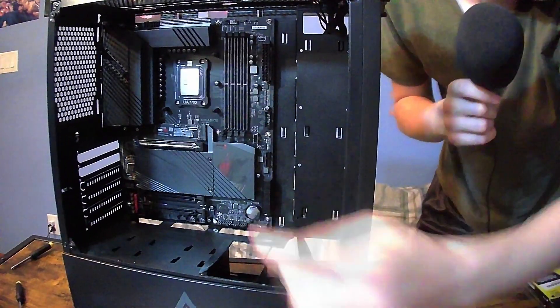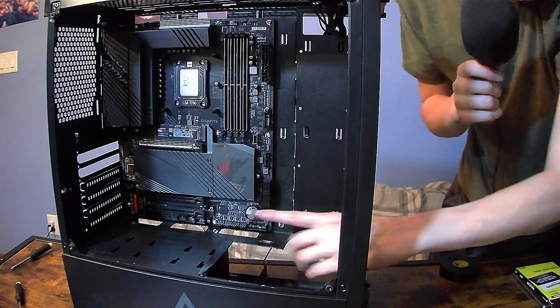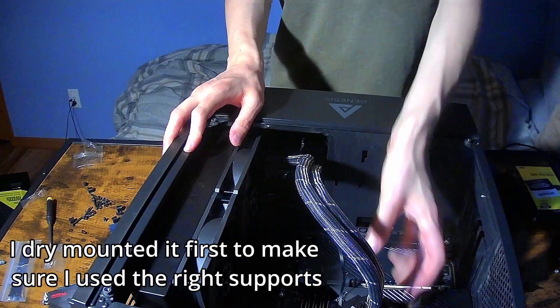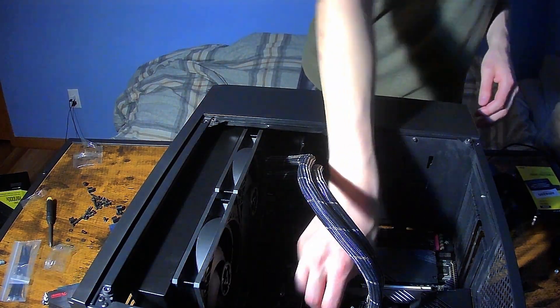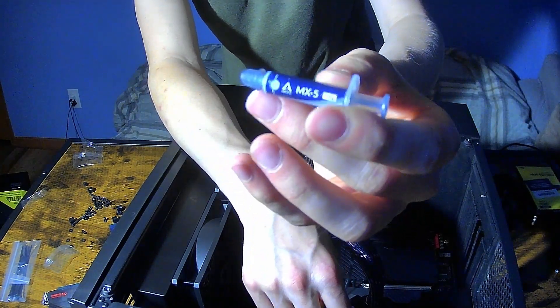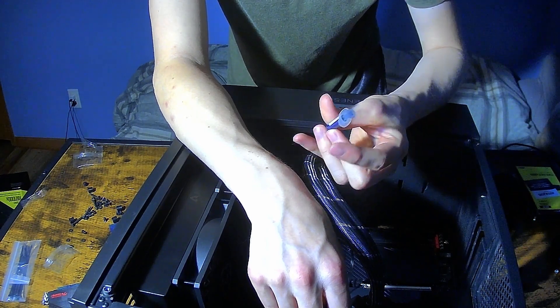I genuinely don't know how many days this has taken at this point — it's kind of all blended together. My cooler wouldn't fit. The radiator, to be specific, because apparently I measured it but there are cords that run along the top here for the buttons, and I didn't account for that. So what I did instead was I cut an absolutely massive hole in this section here so that I should be able to run the thing down that way. That feels snug. So let's take this back off, get the plastic off the bottom, and then do the Arctic paste they included. And if that isn't good enough, I'll swap out for something else.